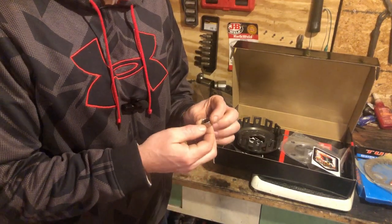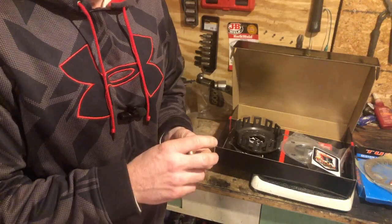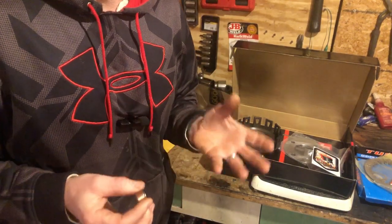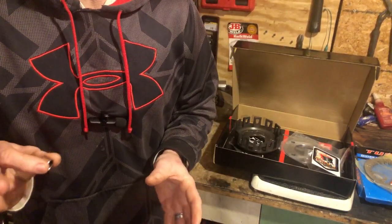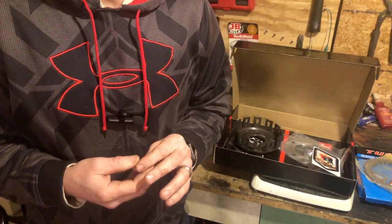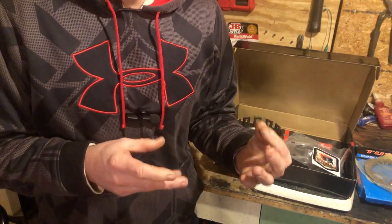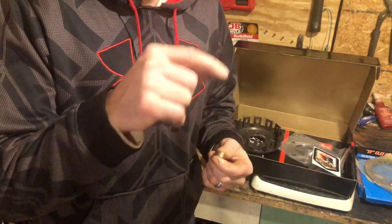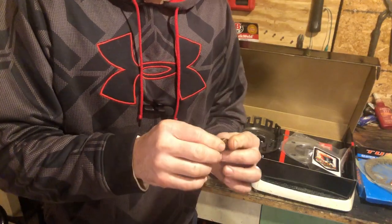So, but yeah, we're going to throw this bushing on here on this idle gear and see what kind of play we have. Like I say, it was damn near a half inch of play in that. When I opened it up, I'm like, because the noise was driving me crazy. And I found another video on YouTube where the guy had the exact same noise, and then various threads. People were talking about it, and obviously there's different types of noises to look for as well. So again, I'm going to post a video of that engine noise, and hopefully we get a good before and after. Let's go ahead and throw this on.